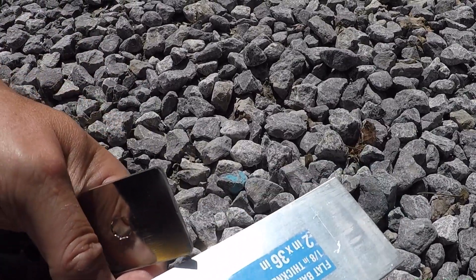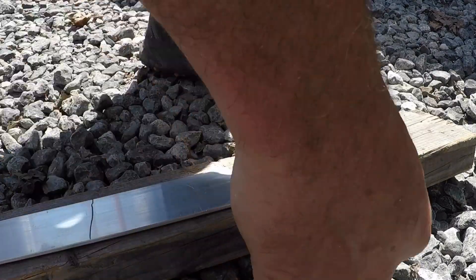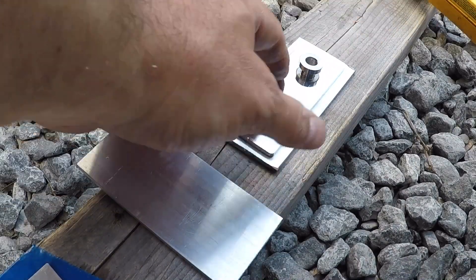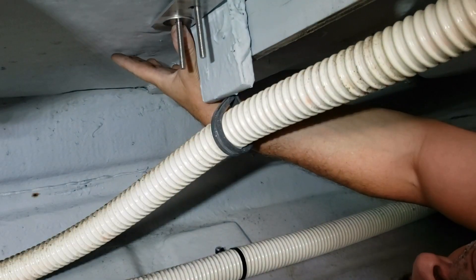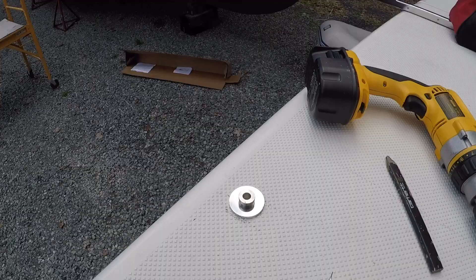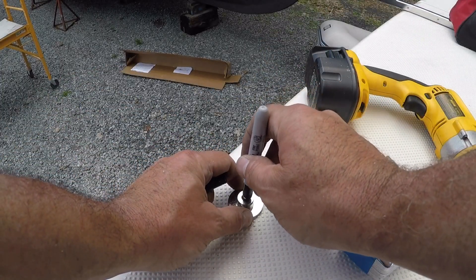I'm going to make a backing plate out of a piece of aluminum bar stock picked up at Home Depot. Having this bar as a backing plate down in the bilge will help distribute the forces pulling up on the bracket — it's much better than just using washers alone. These small single round buttons help secure the rearmost part of the davit bar. It's important to have these in the right location so that the bar is straight and parallel with the other bar.